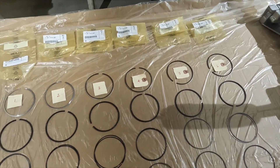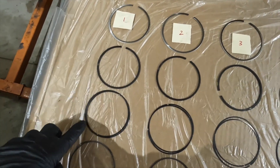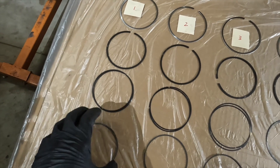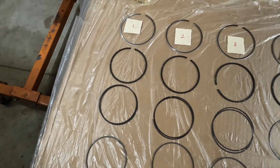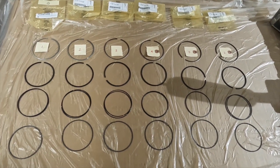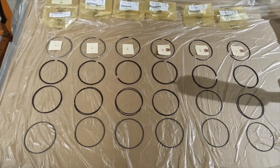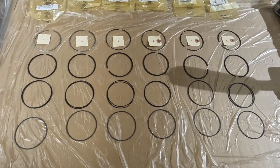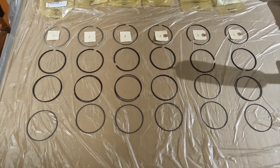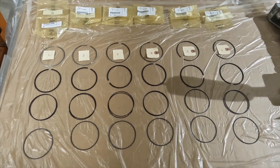I've labeled all the rings for the cylinders I'm going to check, starting with the top ring, second ring, oil ring, and the oil spring ring. Once we start taking the ring end gaps, we may need to flip-flop between cylinders on the rings depending on what readings we get, because sometimes it may be beneficial to move the number two ring to number four cylinder to get a better ring end gap.